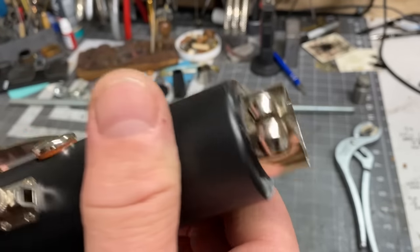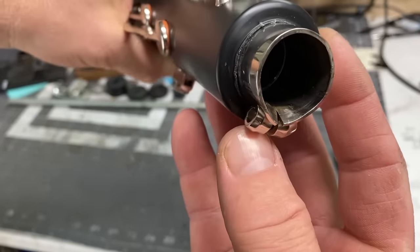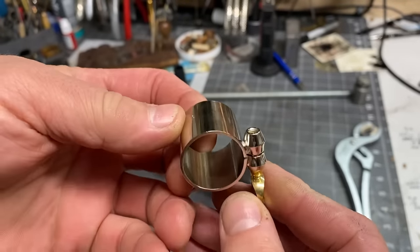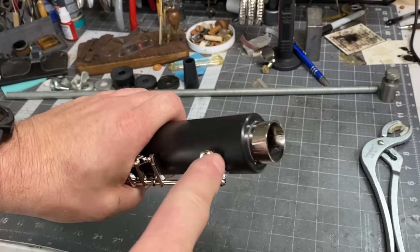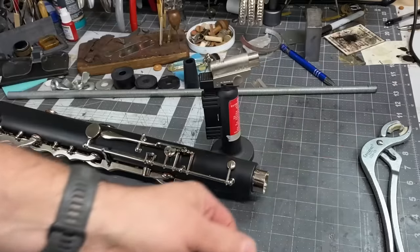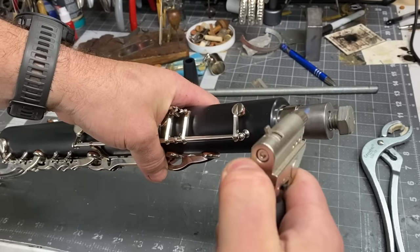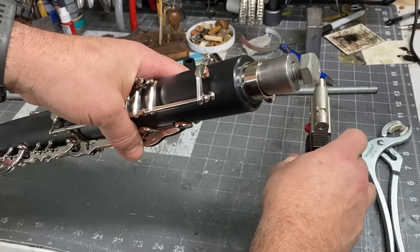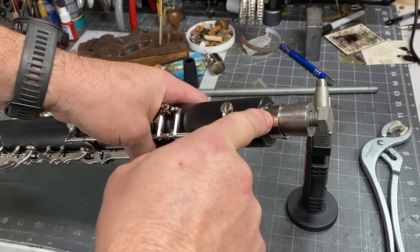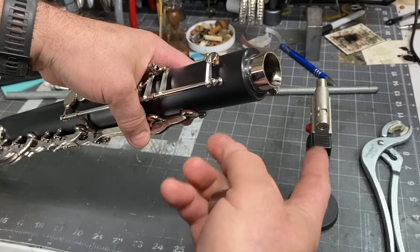What we've got going on is this receiver is damaged, and this is a part that we just replaced. I've already acquired our new part, so we've got to get this out of this plastic. In the old days, you had to use a torch — you had to put a piece of steel in the plug and then heat it, transferring heat from the steel down into the receiver to melt the epoxy, but not hurt the body because you'll melt this plastic body.